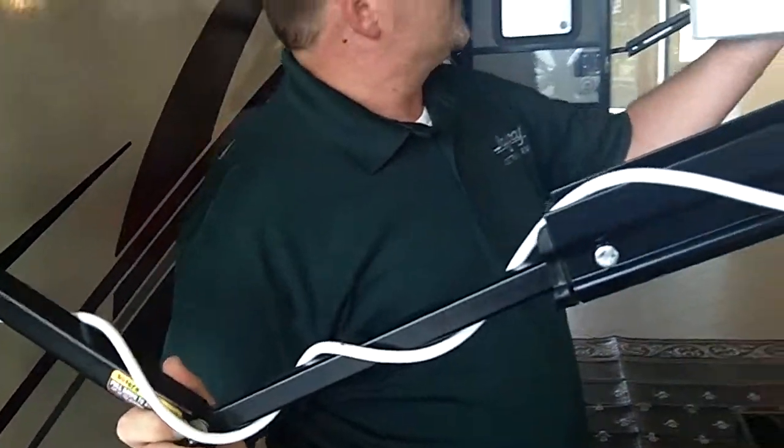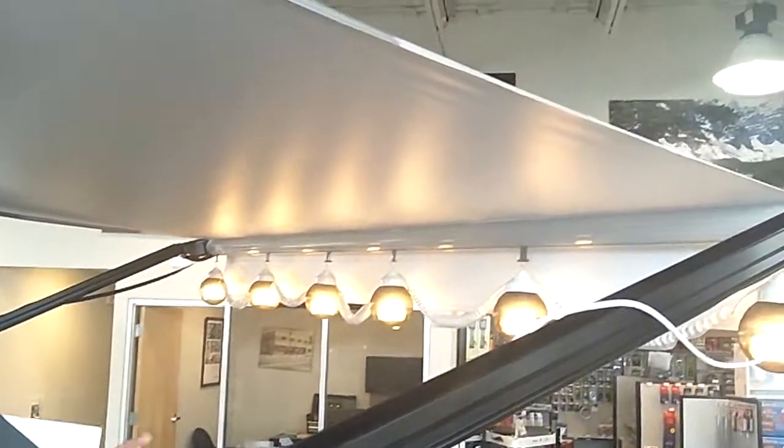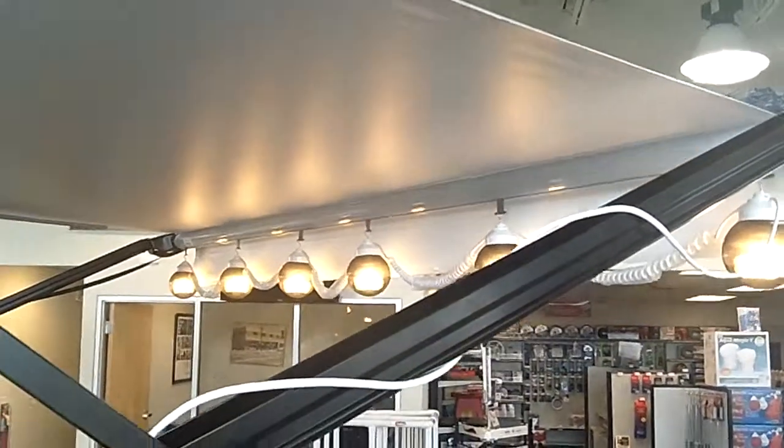Let me show you a little bit about this awning. It's a Lippert awning, and it is an adjustable awning so you can adjust which way the rain goes without having to move anything except this pivot in this arm right here. You can pull this arm down and it drops the angle of the awning so your water runs away from your door. Very good feature.